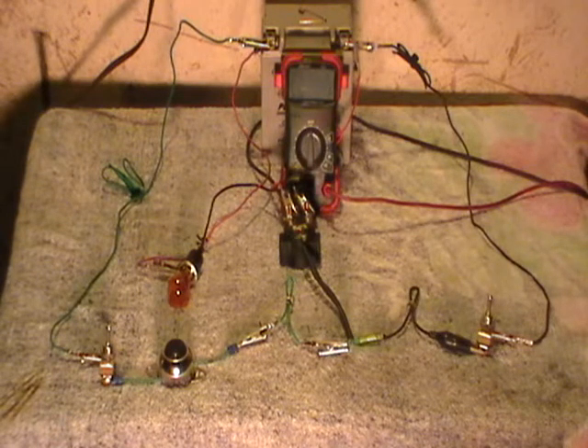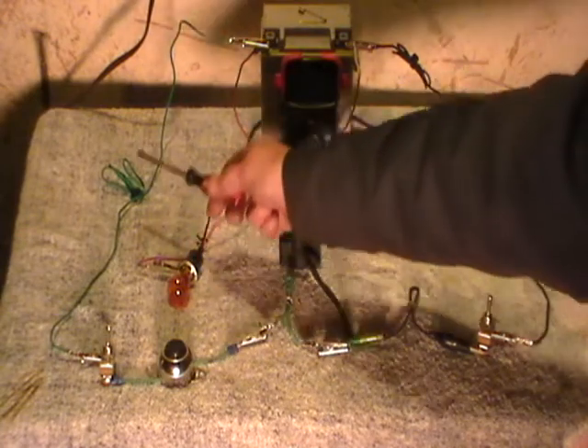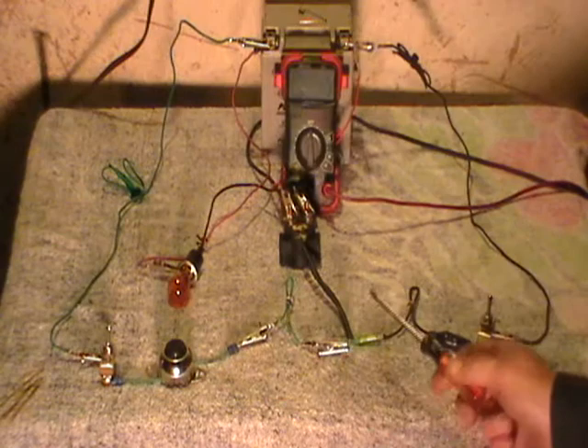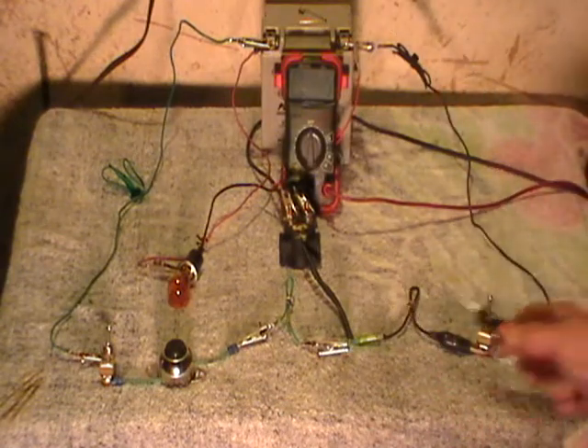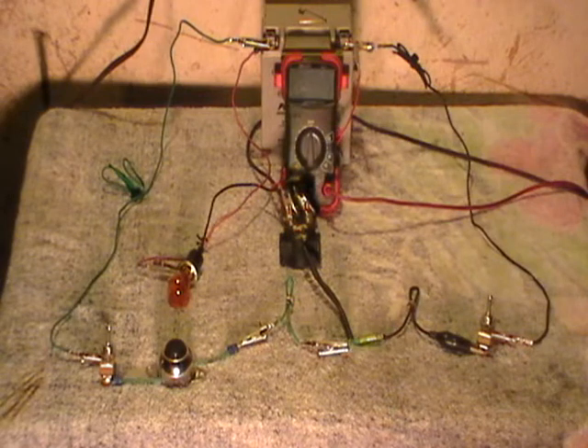This gives us the opportunity to use three types of electrical testing. We can use continuity testing to make sure our path is complete — no open circuits, no interruption in our wires or switches. We make sure our switches are all operational, and then make sure we're getting power to the solenoid that operates the starter.